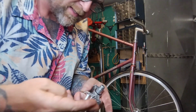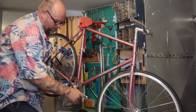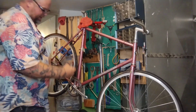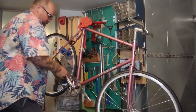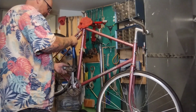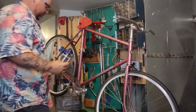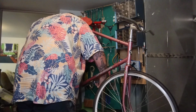We just polished these cranks. They're all nice and smooth. Sanded them all out, big giant fight. Always grease, and pedals are right and left hand thread. These have a big R on them. So we can look at the pitch of the threads, see if it's going right or left. Make sure they're going pretty smooth. They're going kind of smooth. Sometimes you can just spin them. These aren't that smooth. Left hand one I also greased up. Left hand's reverse thread. Since I've been righty-tighty, it's lefty-tighty.